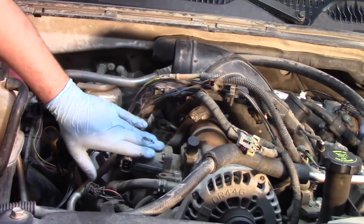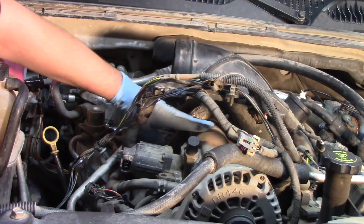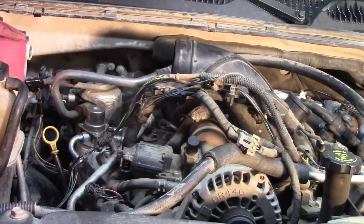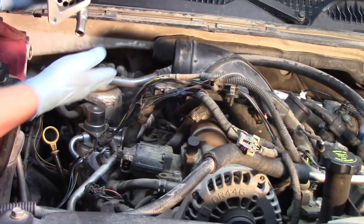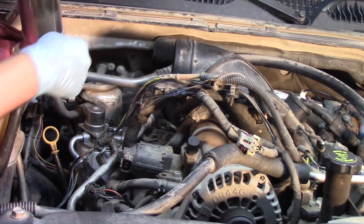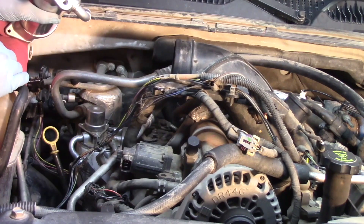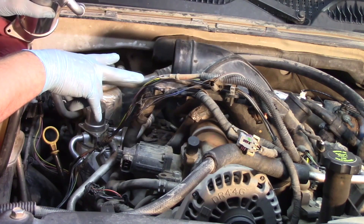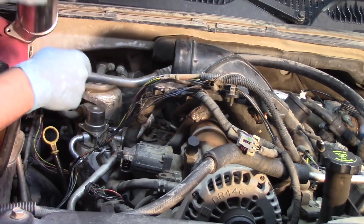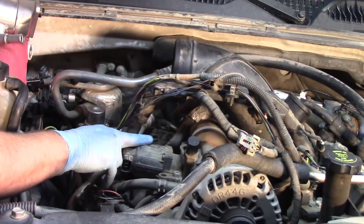This is gonna be a job that's gonna bring this truck back to life. Now that we're able to access the EGR valve and the cooler, we've got a few next steps before we can start removing things. We have two coolant lines that we need to pinch off and remove — one up top in the front and one routed around in the back. We've also got two different mounting holes on the back of the EGR cooler that we'll need to remove the bolts from. So we've got those back bolts, our two hoses to pinch off to avoid a coolant mess, and then a few bolts around the EGR valve itself.